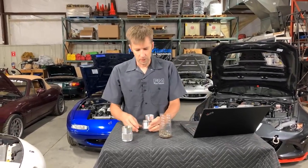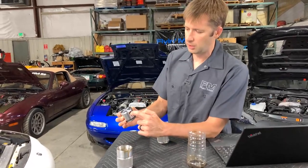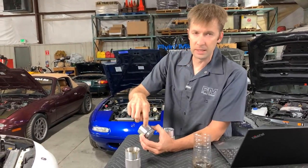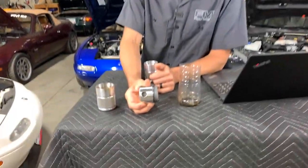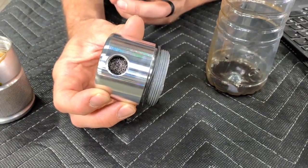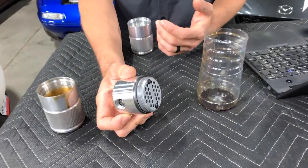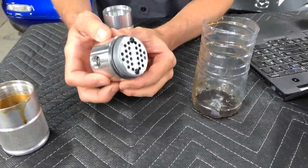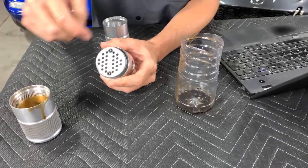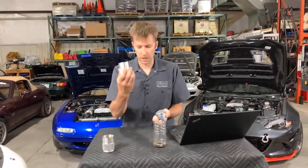So how it works — this is a brand new shiny version of what's in my car. You have an inlet here and an outlet here. Your air oil mixture goes in one side. You can see there's a fine mesh, a stainless steel wool material in there. All the droplets of oil stick to this mesh, but the air passes straight through the other side. It's not a filter like an air filter — it's more of a coalescence filter, just taking it out of suspension. The oil adheres to the mesh, the air passes through, the oil drops down, and here's your can. All the gross stuff drops down and you can pour it out.